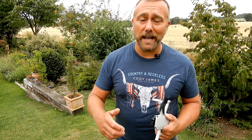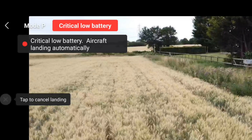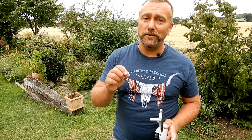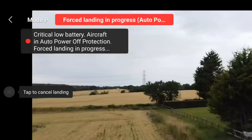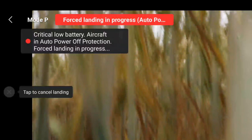So the Mavic Mini lives to fly another day. That was a good demonstration of the critical battery auto landing sequence. When the battery gets too low, it will go into this critical landing sequence. And initially, you can actually prevent the descent — if you lift the left stick, it will rise up temporarily. But you can only do that for a very brief period of time until the battery gets down to its critical, critical level, and the drone realises it is about to deplete the battery completely. At that point, no matter what you do, the drone will descend. If it's over water it will go swimming, if it's over a crop field it will just descend. And that's what happened there.